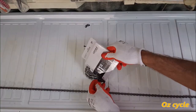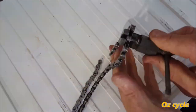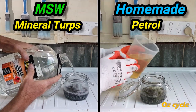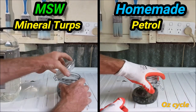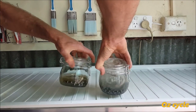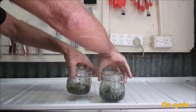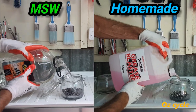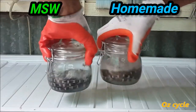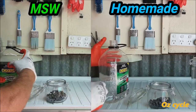We'll make sure the chains are the right length for the bikes and identically the same length. Brand new chains come with factory lubricant, which must be removed completely before waxing. The Molten Speed Wax chain goes in mineral turps and the homemade chain in petrol. Give them a shake and let them soak overnight. The next day, shake again and empty the contents out. The Molten chain gets another soak in mineral turps, the homemade chain soaks in degreaser, then gets rinsed under water and allowed to dry.